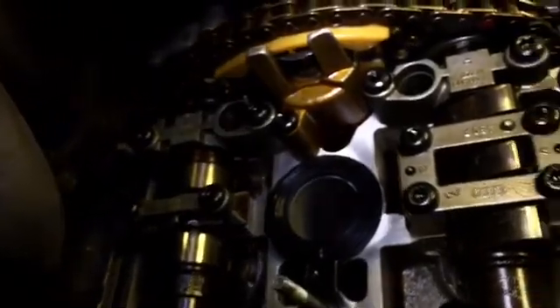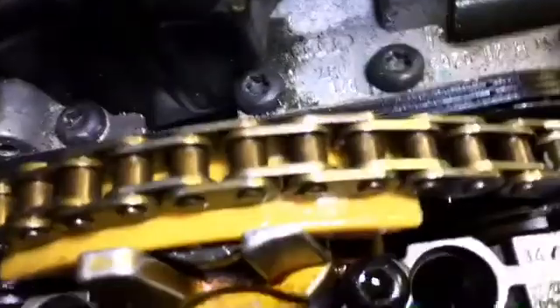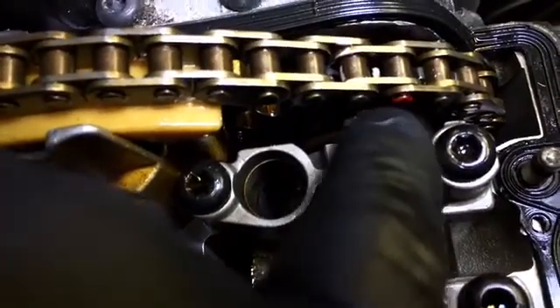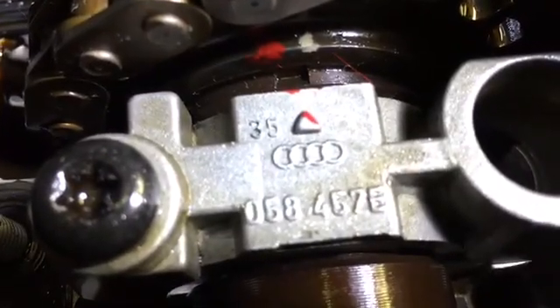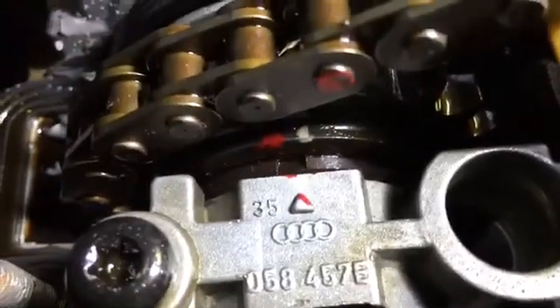This one had the head replaced and everything was machined — cams and everything put in here. On the intake side you can see the arrow and the notch. If it were right in front of that notch or arrow, this would be straight up, right in the center. The other side is where the problem is — that one is kicked off to the left. My link needs to be one position to the left, so I've got to move that one link over and it'll be correct.